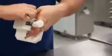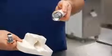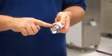When cleaning the dispensing door, you'll begin by removing the O-ring on the end of the securing pin. Then pull out the securing pin. You'll pull down on the handle, lift as high as you can, turn slightly to the side, and lift again. This will help you remove the control piston. On the control piston are 2 more O-rings. They will also need to be removed for cleaning.